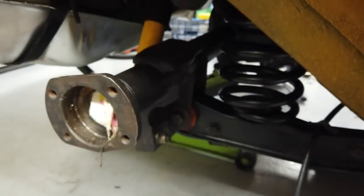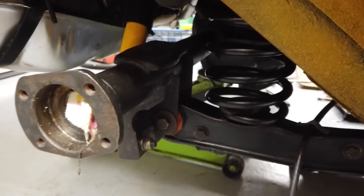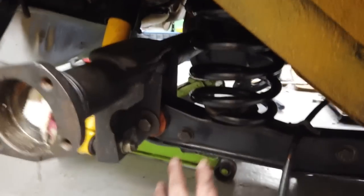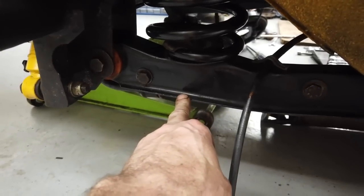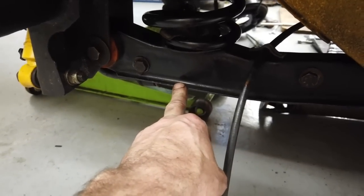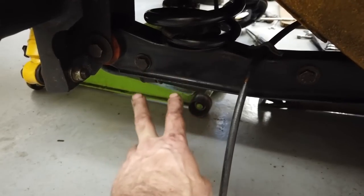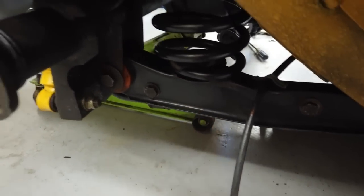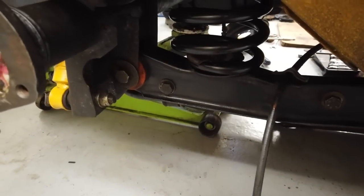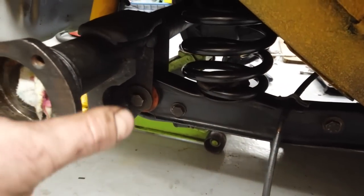And indeed, on early Cortinas, the serrated plates were part of the design. They then got rid of it. Someone did reason that they could have altered the length of the lower arms to also create the same effect. And that's what they could have done on later cars, because we've been reading recently in Classic Ford Mag that ideal suspension setups involve using lower arms off Mark V's, which tells us that perhaps there are different lengths of lower arm which could create the same effect as twisting your axle.